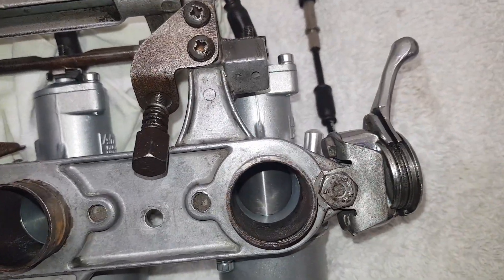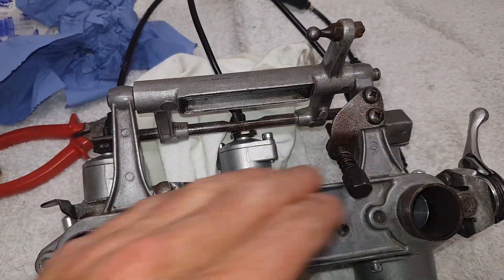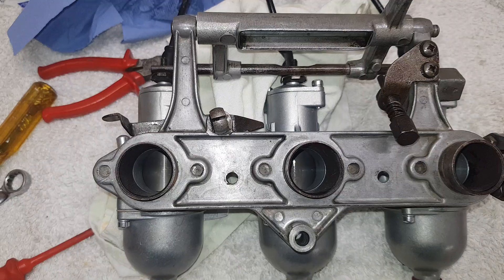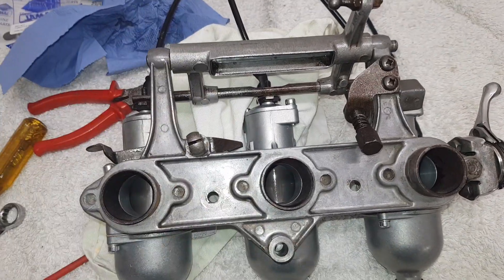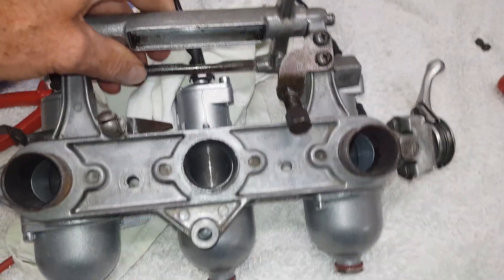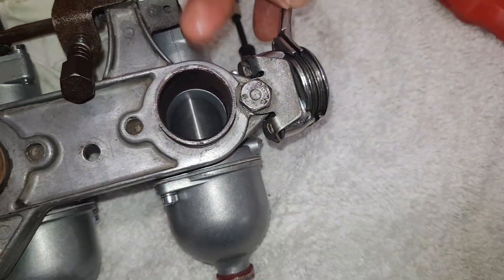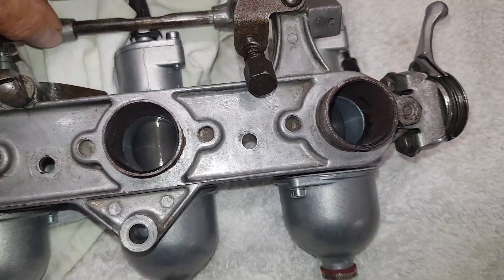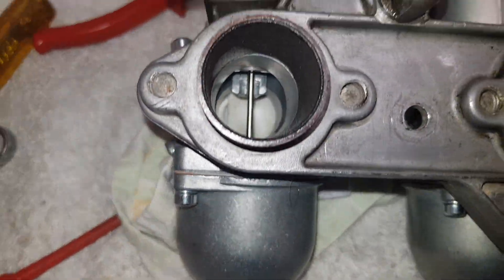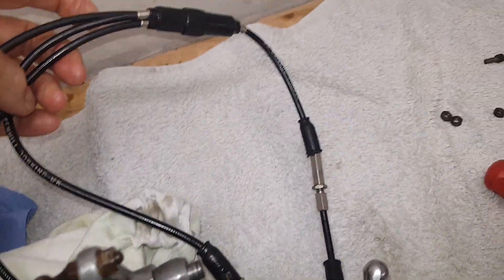I think we are synchronized, so I'm going to put the lock nuts on and then check it all again, check the things up when the lock nuts are tight, then we're going to put the throttle linkage on after we synchronize. Also, the next thing I'm going to do is set the choke. The choke is now fully off but I haven't set the cable yet - that one's about three-quarters off, that one's only two-thirds off, and that one's about two-thirds off. So I need to play about with the adjustment on the cable.